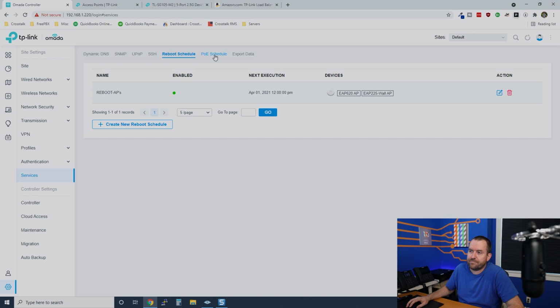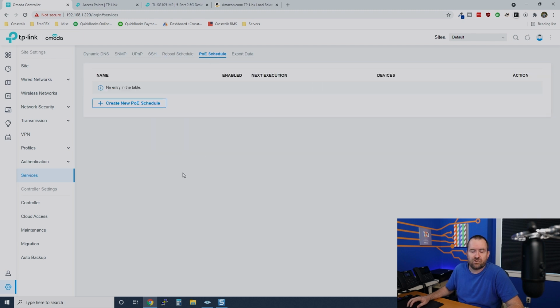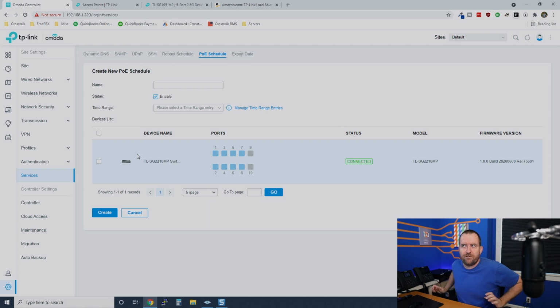Pretty cool. There's also PoE schedules. Remember I told you I set up my business hours just a couple minutes ago. Let's say I had a whole bunch of voice over IP phones plugged into this device. And maybe I wanted those phones to shut off at night, right? Maybe I don't need them on all night. So if normal business hours are 8 a.m. to 6 p.m., well, outside of those hours, let's just turn off PoE on the ports that control my voice over IP phones. That way we're not wasting that extra electricity by having those phones on all night.